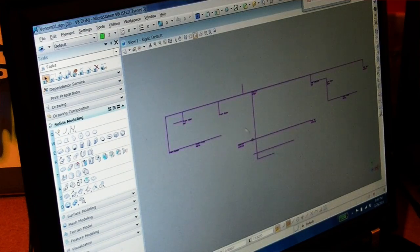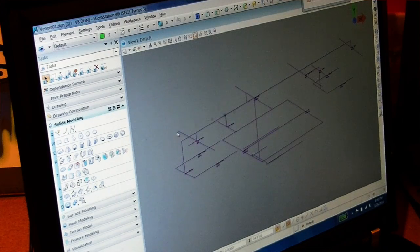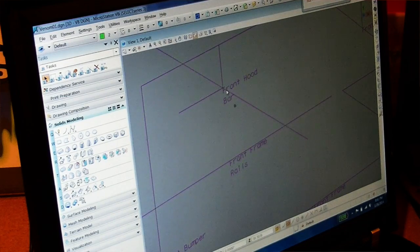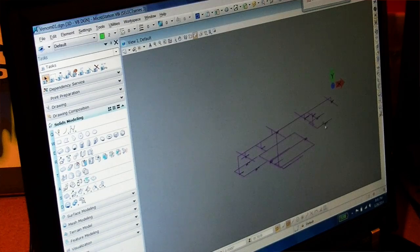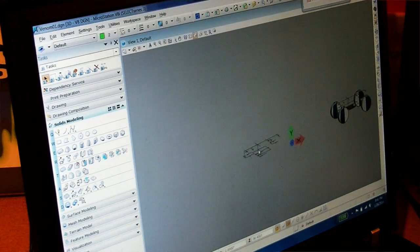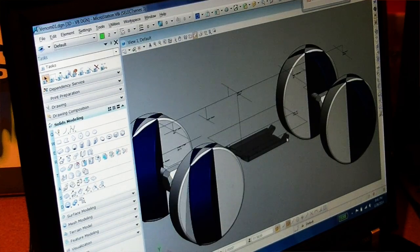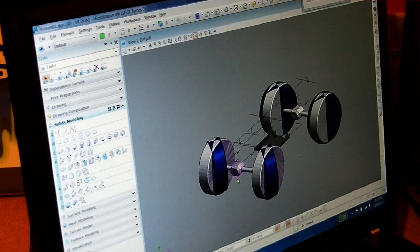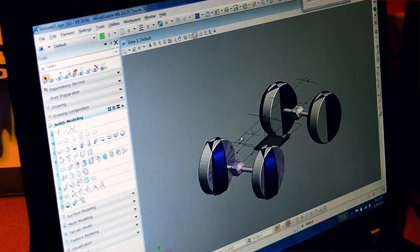I showed you this drawing on the very first video — these were the control points I grabbed from the original Wraith chassis and skid plate. I've got all these labels as to what they are: front hood bar, front frame rails, bumper locations, and all the different things I wanted to pay close attention to. I also brought in a Wraith skid plate as well as some mock-up drivetrain. These aren't modeled axles, they just represent what the axles look like. I have fully modeled axles in my solid design software, but for this I don't use that level of detail.